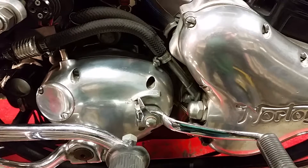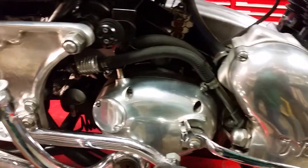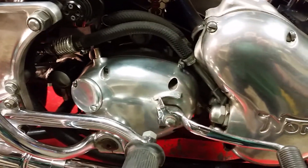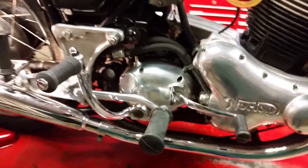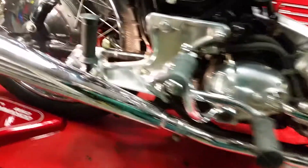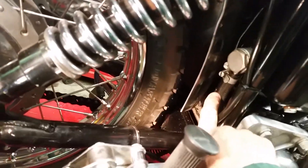In the Mark 3 they did have a device that would do the same thing — it was in the timing cover — but it really didn't work all that well. They realized there was a problem of oil leaking past the oil pump, filling up the sump, so when you start it up you would get smoke coming out of the exhaust until the sump was emptied out and everything equalized.